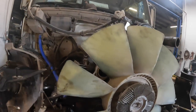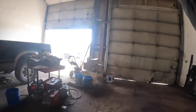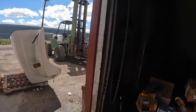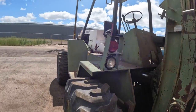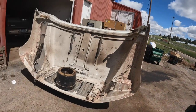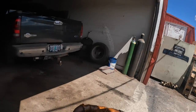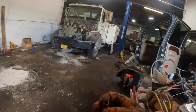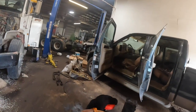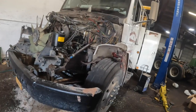So I have no dipstick. Maybe it's still out here on the forklift. Yep. And both of them, both blocks broke. So I ordered one from Cummins, but I couldn't get them out. They're serrated to where they grab in that hole in the block, and you can't get them out. You've got to beat them out of there. So it's kind of like a male-male nipple type deal, because the other end's still in the dipstick tube, wherever it is.